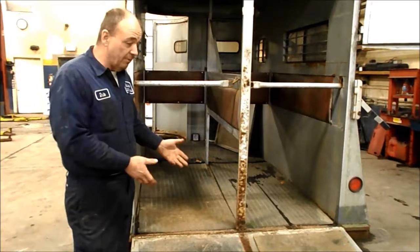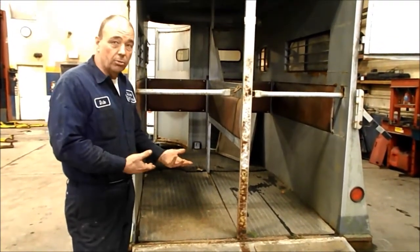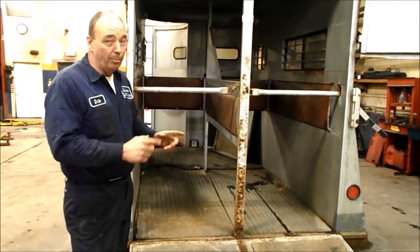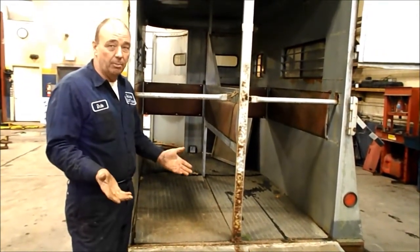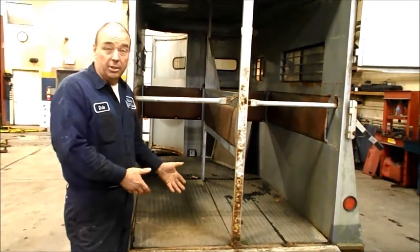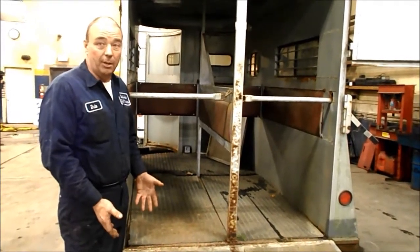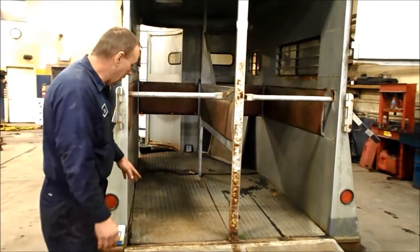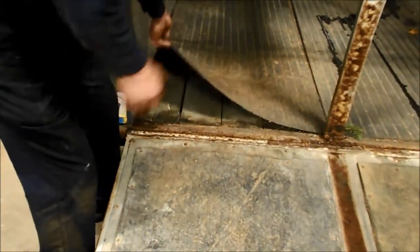If the ramp is heavy before you make the purchase, call a local trailer guy. That's what's great about smartphones — take a picture, send it off and ask: is this going to be fixable, can you get parts to repair this? Because that will determine whether you want to buy it. There's nothing like buying a trailer you can't lift the ramp on. Come back to the back of the trailer, lift the mats, and look at the wood to see if it's rotted.